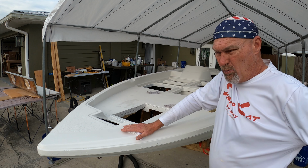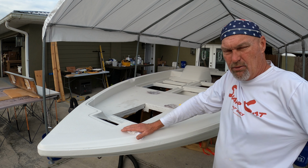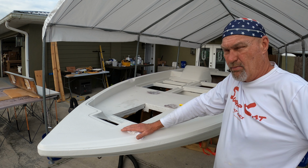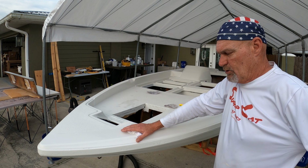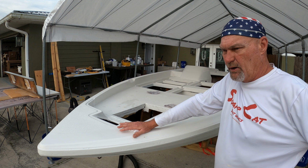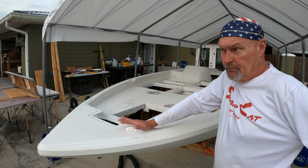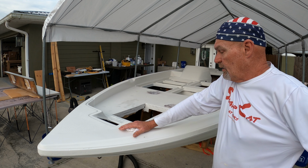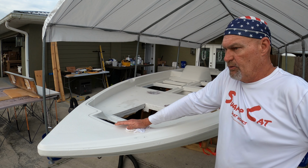we're going to do a rough sand on the whole boat, and then decide whether it's a full coat of the primer for the 3rd coat, or I'm just going to spot prime areas that we actually sand through that have to be recoated. Because if you don't recoat the Total Fair, they say the gel coat will blister over time. So we're going to coat this kind of stuff and just carefully sand this before we put gel coat on.